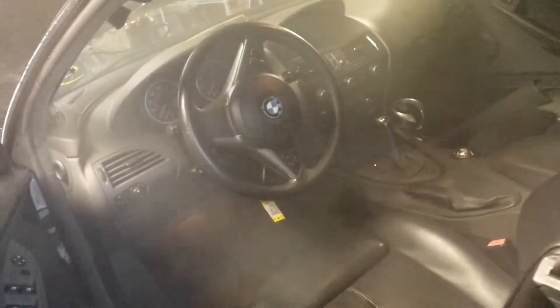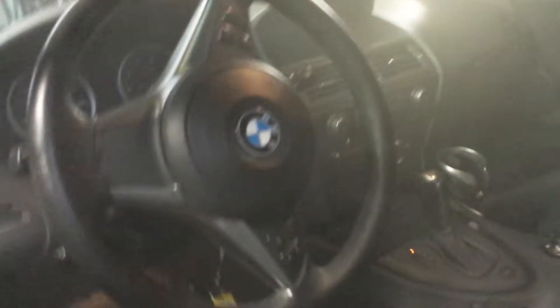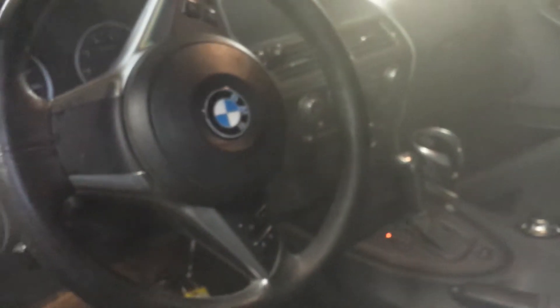Let's see what we find. There you go — it shouldn't do that. So this car, the complaint is the brake pedal is hard all the time and it's hard to stop. I'm going to recommend a brake booster.